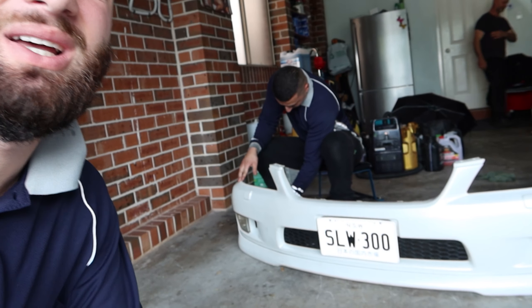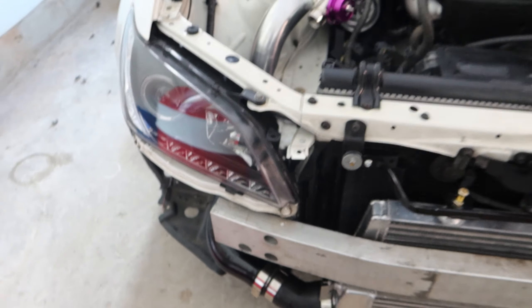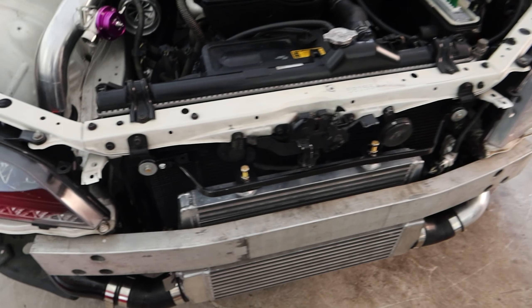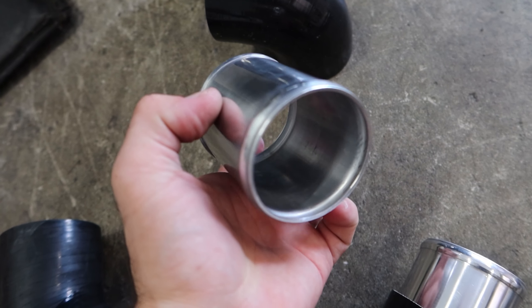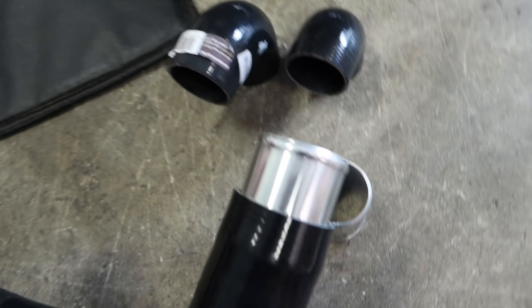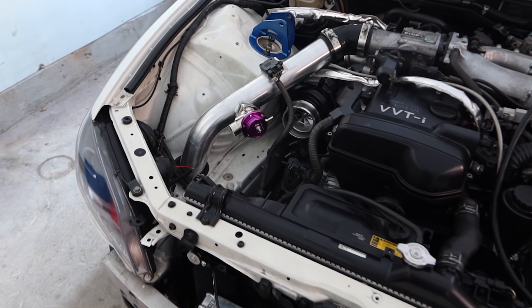Before that we've got Nigel in the back trying to set up the bumper bar — we still haven't been able to put that on — but we have fixed the problem we had with the intercooler piping. It's all on, nice and flush. We've got extra joiners and this extra pipe from the kit that wasn't in the CX Racing kit, which now makes the CX Racing kit suit our Treadstone manifold. Here are the extra pieces we had to buy: three 63mm alloy pipes, a 90-degree 63mm bend, and another 90-degree larger 63mm bend — three of these used as joiners to make the whole piece line up.